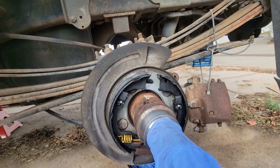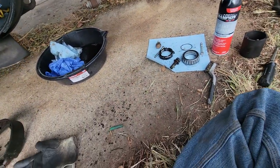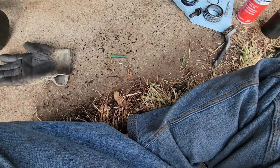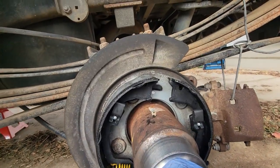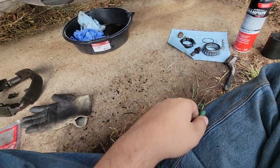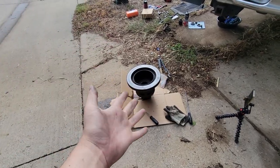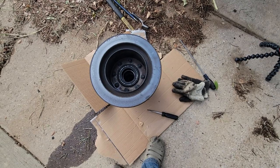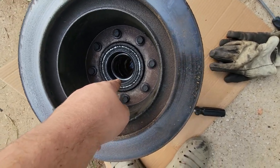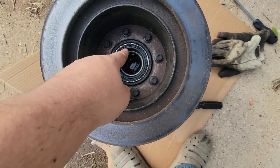Now I just gotta get the brake adjuster in here. Gear towards this side because that's the way it is on the other one. I got them spaced out about the same, so I'm just going to spread that, put that in there, and then get that spring put in by using some pliers. So the cardboard didn't soak up enough of the oil. We gotta take out that seal — the bearing rides just on the inside of that. You can see all the gunk from where the seal leaked all on the inside.